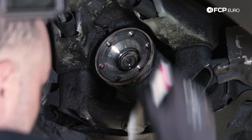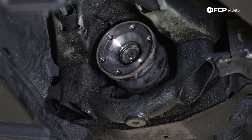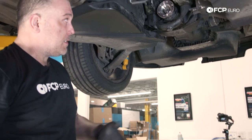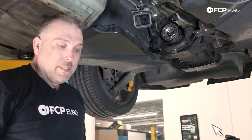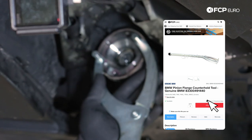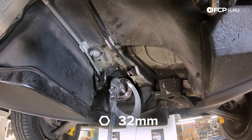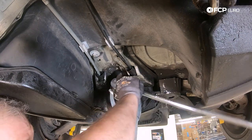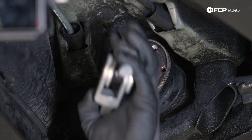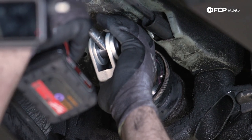The only way to ensure this is to paint mark it. So we have two visual marks — both the paint marks and the stake marks. If one rubs off, I'll at least have something to back up on. This is a special tool from BMW specifically for these differentials and pinion flanges — pretty much all the limited slip differentials use the same size flange. This is a counter hold tool that slips into the holes and allows you to loosen the nut. It broke free nice and easy. The pinion flange is really stuck, so we're going to have to use a two-jaw puller. BMW does make a special puller for these flanges, but a two-jaw puller should do just fine.